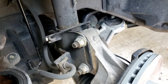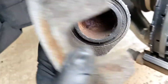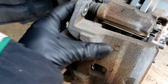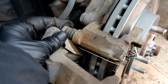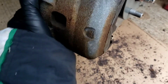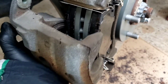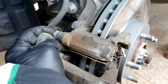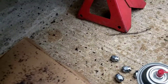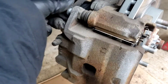Now we're going to take this caliper and put it right in here. Don't forget to lubricate it — forward and backwards — with the package of lube that it gives you. Push this thing in with one hand, that'll sit in there, this one will sit in there, and then we'll put the other bolts on. Put back your 14s and this side is good to go.